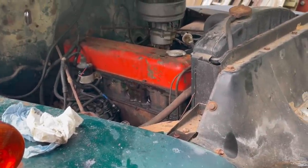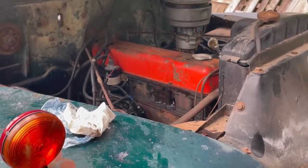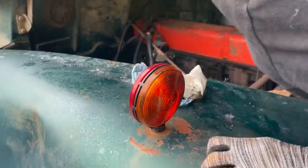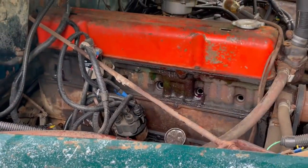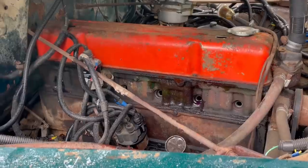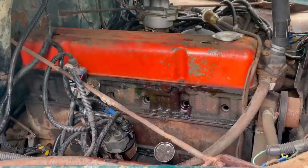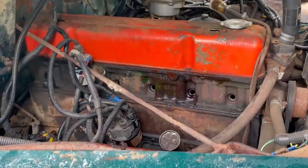Blowing it out the first one. Yep. Okay. That's all I could see. Second one, last one. So why would it do that? Why would it blow only out of two, not all six? The likely reason for that is that it leaked past the rings on the others into the crankcase and didn't sit in the engine, in the piston.